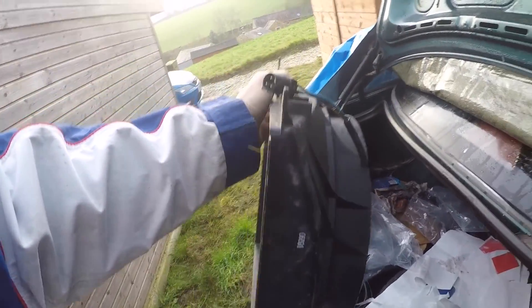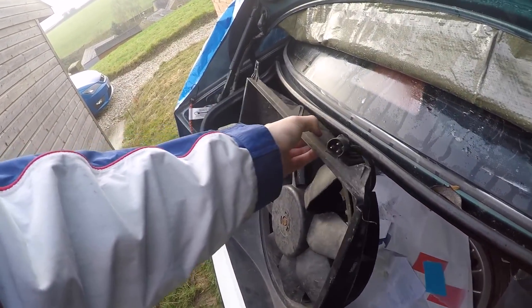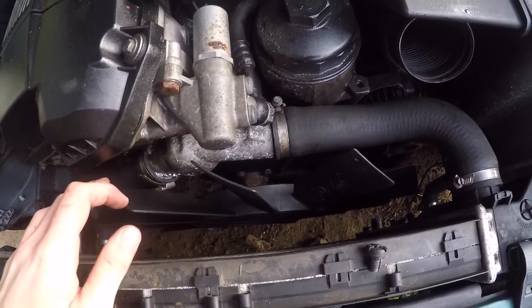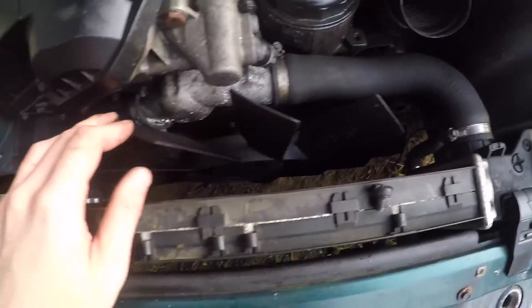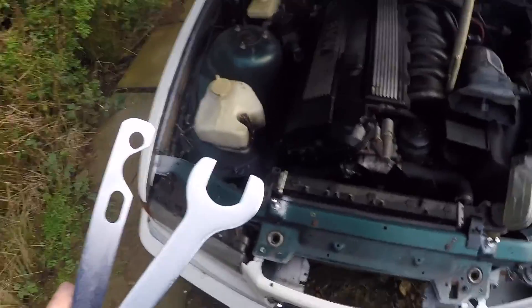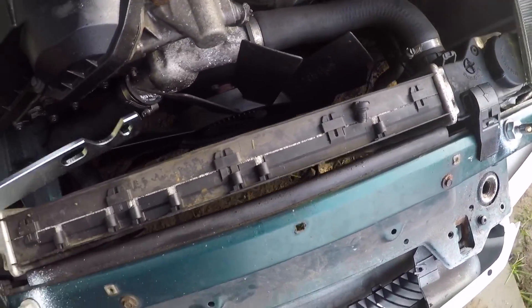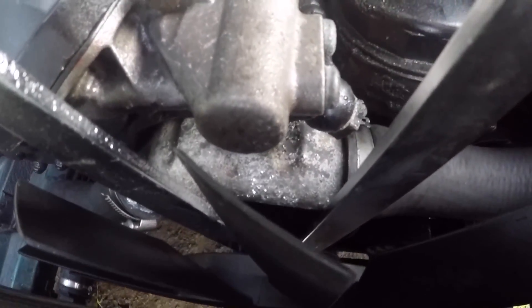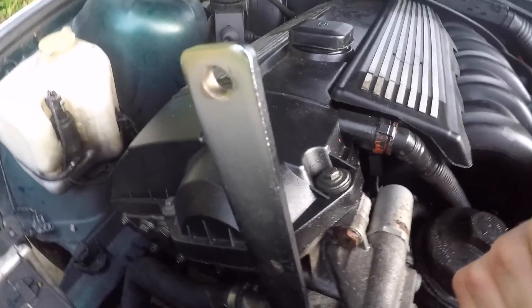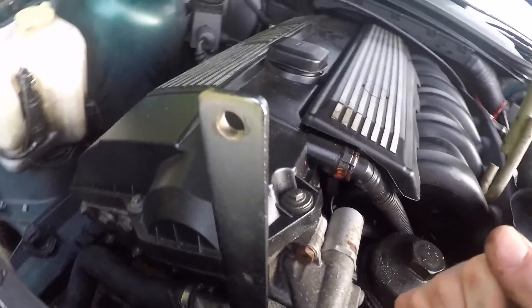The only issues I can see are that this fan is quite thick — it's good that it has a shroud with it, but it is quite thick. You have to get the clutch fan off — these are reverse threaded and you can jam a screwdriver, but here's a quick tool for about £10: this holds your water pump in place, and once it's clamped onto the bolt on the water pump, you get your spanner. It's reverse threaded, so you need to actually tighten it — go to the right — for it to come off.